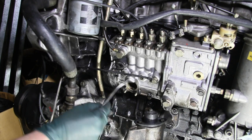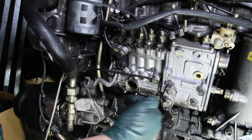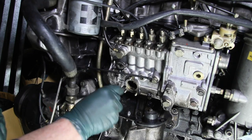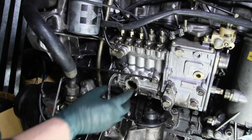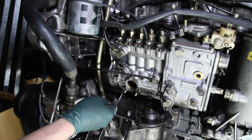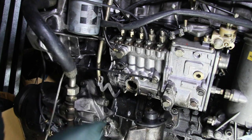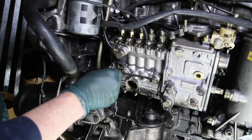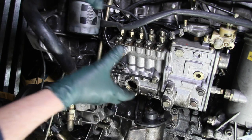Getting to the back brace bolt right here can be the most difficult. Using the snake wrench, getting on the top nut is not a big deal — you usually have no problem. Although on some engines you've got certain hoses there, so having this angle and this bend lets you choose your approach. You can even come in from a different angle if you have a clearance problem with hoses coming off the engine. But getting on the lower one is where this wrench really shines. You can bring it all the way up, get a bite on it, then loosen it — you only need about a half to three-quarters of a turn.